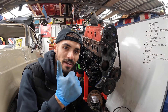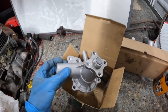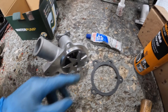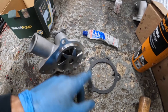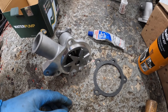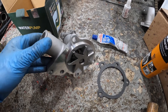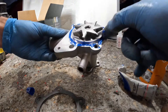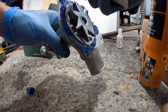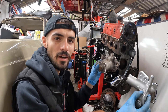Also from Burton Power I bought a water pump, and it comes with a gasket as well. Same sort of scenario - I've got my blue gasket sealant and I'm going to put a little bit on there. Some people might say you don't need it but I just like to do it - belts and braces sort of thing. Then I'll marry up the water pump to the engine. New and old next to each other - let's get it fitted.